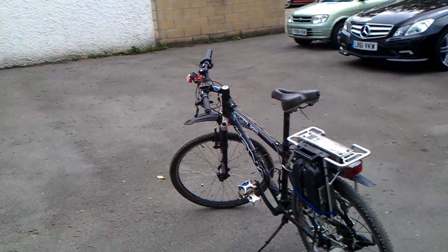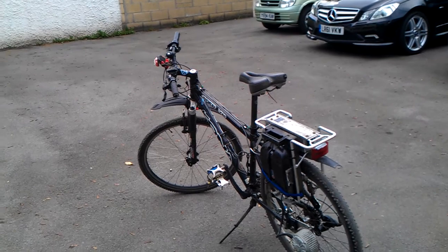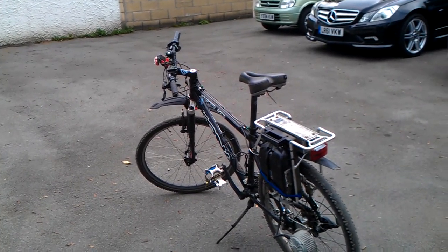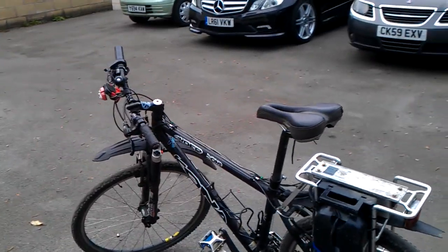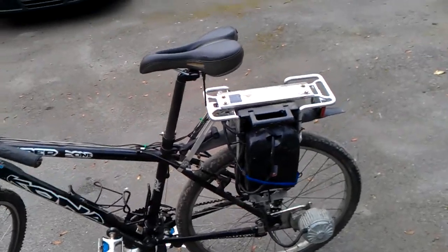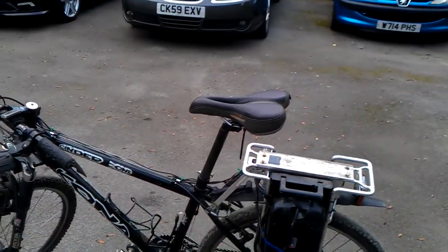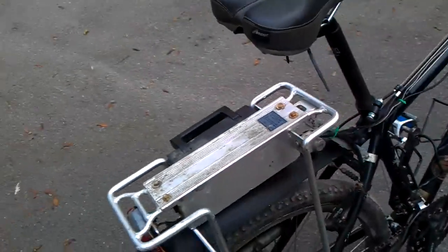Pedaling along, you can quite happily maintain something about 15-16 miles per hour. It's got a 24-volt rear light built into it. It's a bit cobbled together because the battery system when it came was just a 24-volt lead acid type. I fitted a lithium polymer battery on it which still has plenty of life left in it, and the charger is here as well. It's got a rear carrying pack on it and you can actually fit another battery onto the back of it.